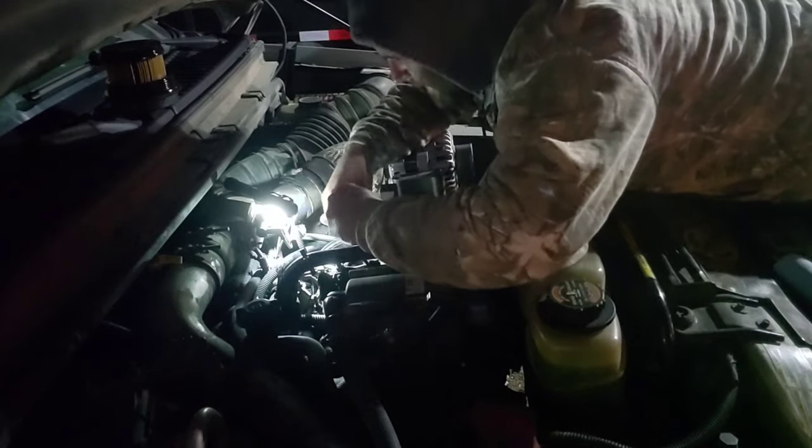This piece does not come out of here at all unless you take the heater out. Once you take those bolts off and pop the heater out, this will pop out — this is where the centerpiece of your filter goes. Just keep in mind there is a spring underneath this, so when you put it back together, the spring has to go on first, then this piece, then you slide the heater over top of it, put it back down, and bolt it up. That plug used a little finesse — it's kind of a bear to get your hand down in there to get it lined up, but we got it done.